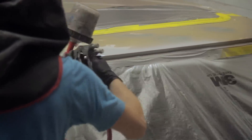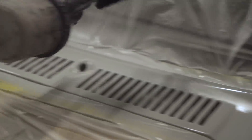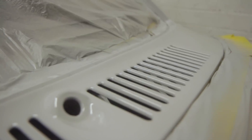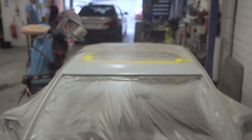This primer is another piece of the puzzle when it comes to getting the panel perfectly flat. Something I never knew — when you see orange peel in a car, it's because the primer stage of the paint job wasn't flatted back. I thought orange peel happened in the top coat or clear coat, but if this job is anything to go by, the clear coat doesn't produce orange peel. With time between coats to dry, Gar is giving this car three coats of primer to build a nice thick layer that we are going to sand back — flat it, as they say.